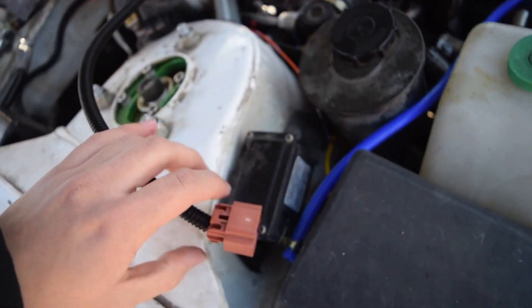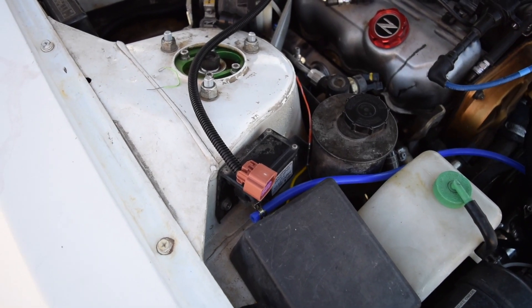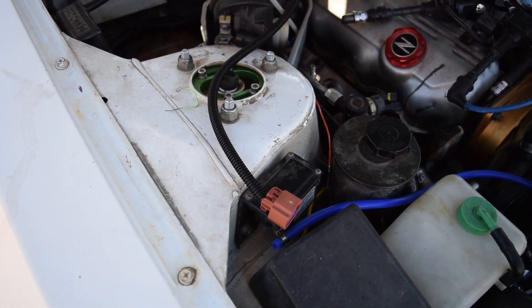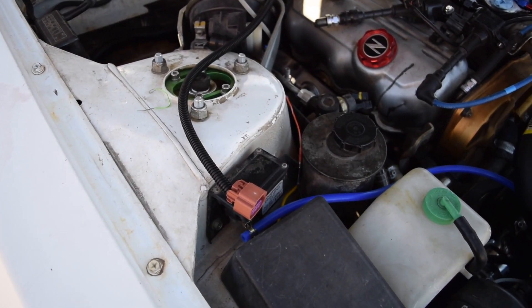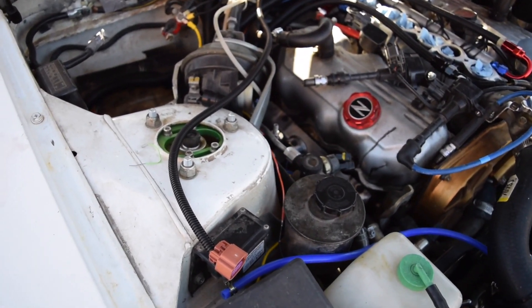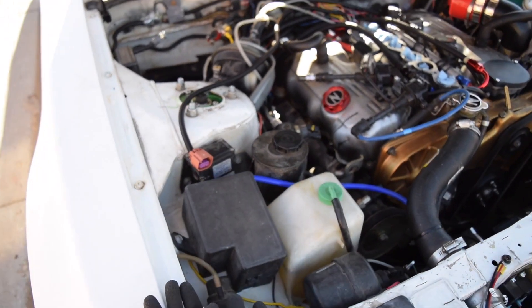Now I'm running flex fuel. This is my harness for it — I haven't actually plugged in the sensor yet, but it is also a three-pin. The flex fuel sensor actually uses a switched 12 volt power, so you don't need to do the 5 volt for this one, but you do need the sensor ground for it, and it also has a signal wire. I believe mine was pin eight. It wasn't labeled explicitly as flex fuel — I just put whichever wire was in pin eight into it.